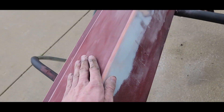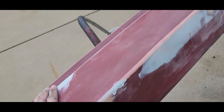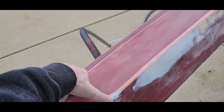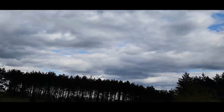It's a different night — ignore the air compressor. I really wasn't gonna film anything tonight, my back's killing me, I had a day at work, but I'm out here working on the bumper. Just using 180 on the DA to get it down, sanding off the body filler and get it in primer. I'm gonna try to prime it tonight — it's not looking great out, so we'll see what happens.